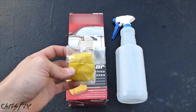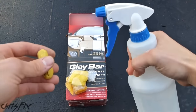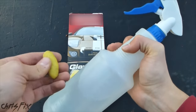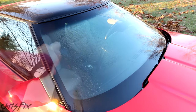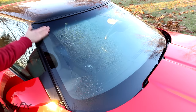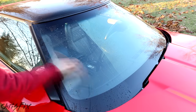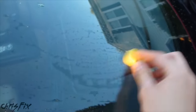The next step is using a piece of clay bar. I have a clay bar kit here — normally you use this on your paint. Just break a little piece off. Fill a water bottle with warm water; the warmer the water the better, because warm water breaks down and dissolves dirt better than cold water. You want a good amount of water to help the clay slide along the windshield. Move the clay bar in an up and down motion and then a circular motion to clean at all different angles. This will pull up any contaminants really stuck on the glass. If the clay gets hung up and is hard to move, focus in that area because there are contaminants there — once it's clean it should slide nice and smooth.